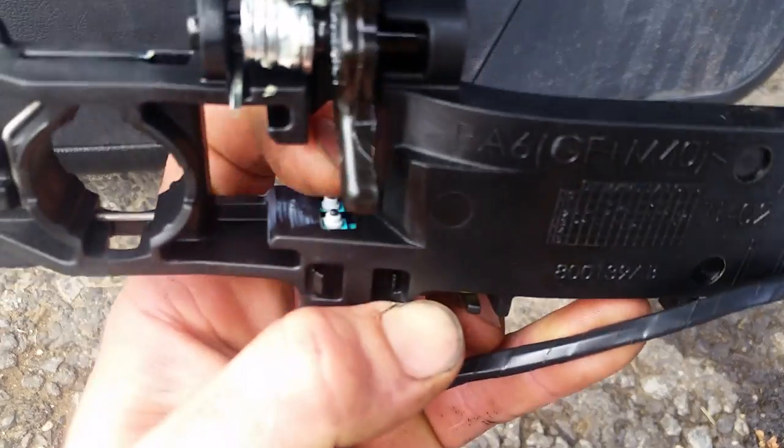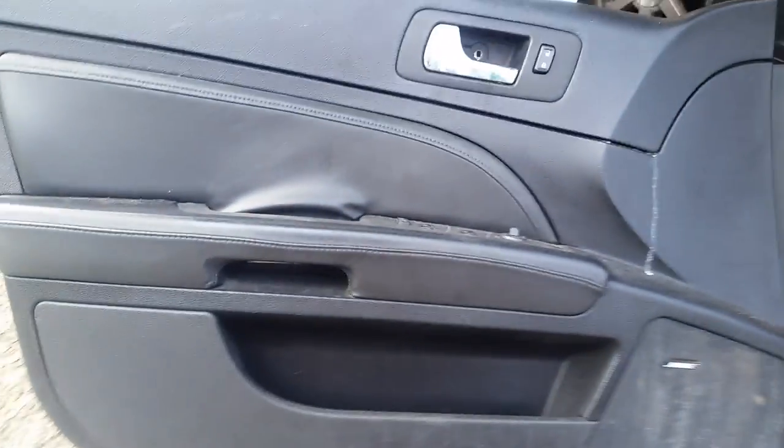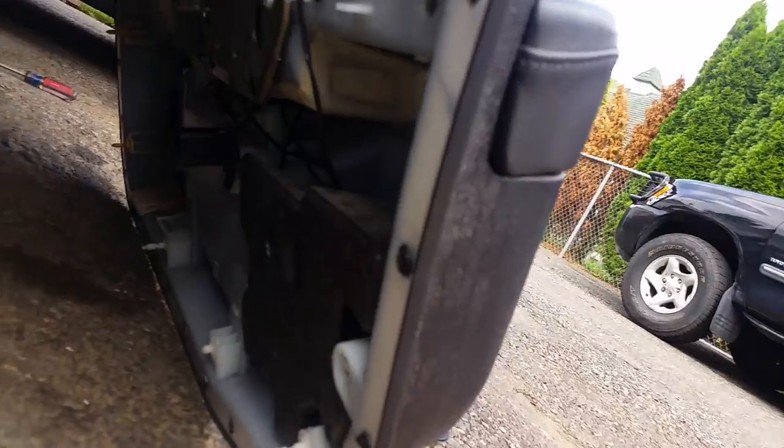When you're taking the door panel off, pull up — you've got this leather down here. Reach in with a plastic screwdriver and pull up the bottom. Underneath that there are two Phillips screws, and there's also one Phillips up behind this cover. Otherwise it's just quick disconnect pins all along the back side, and you have one electrical connection right down in the middle.